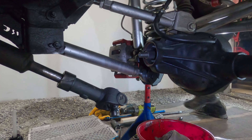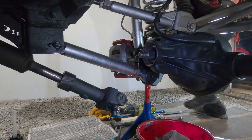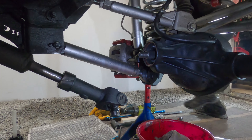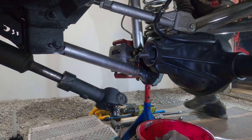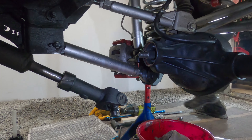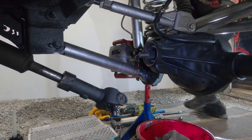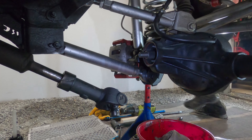A lot can go wrong, and you've got one shot at it really. If you put it together badly and start driving it, you've probably already screwed the teeth on the gears — there'll be metal dust in there. Maybe you can salvage it but the reality is you've probably ruined it. It's got to be right. These things are built to mesh together to the thousandths of an inch — they need to be right. Anyway, it's in there, I'm just going to check the backlash.